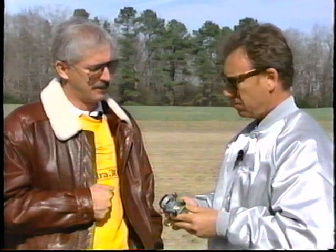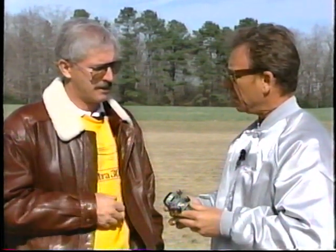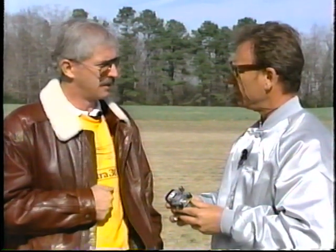What about mounting soft mounts on a four-stroke? Right. It does take a little bit different of a setup because of the tremendous amount of vibration a four-stroke has. I know that Sullivan is working on one and it's about to be released. Gator has one which some competitors are using quite successfully. I would recommend soft mounting your four-stroke if you can find a good soft mount for it.